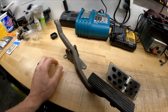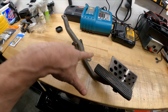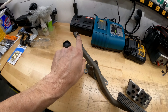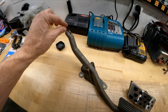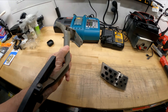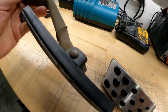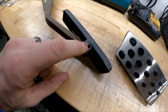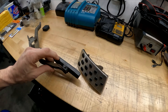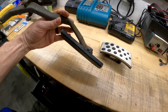So I decided to go and do the gas pedal. The best way to do it: there's two 13 millimeter nut studs in there. You take the nuts off and then the top here is a little plastic bushing that holds the throttle cable — you just wiggle that out or take a screwdriver and pop it out. Then the cable goes right through the top, and you take this over to your bench vice. You see how that's got a head on it — this side doesn't — so you want to put it in the vice and drive this out with a punch. Once you have that all the way out, the replacement piece goes on just like this. Pretty straightforward — I'm knocking it out real quick.